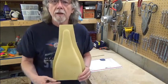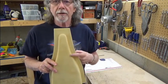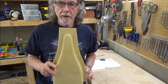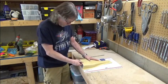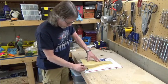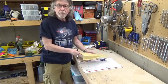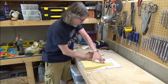If you notice on the inlet, this edge is a perfect copy of the entry edge where we're actually going to be creating the template itself. I'm going to use this outer edge as a guide to form that template. I'll start on this side, positioning the inlet just slightly down from the marks I created, and continue along this line all the way up to the other side, then change positions and do the same on the other side.